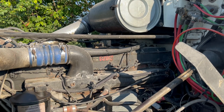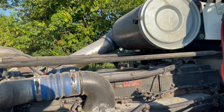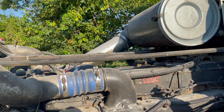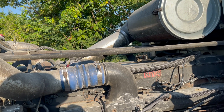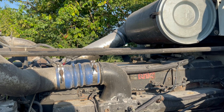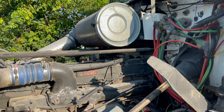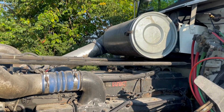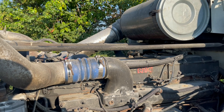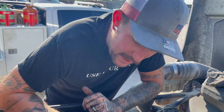We're going to go ahead and put them in today, so I'm going to give you a rundown on how to do that. Right now we're going to work on pulling all the valve covers off. On these engines the heads are all separated — you've got three heads on an N14, so it's got three small valve covers. You don't have to take off any of the extra railings or the intake, so we can just go ahead and remove these valve covers and get to work.